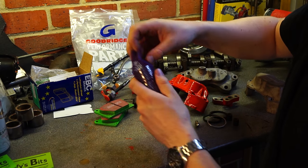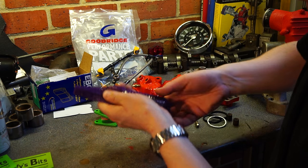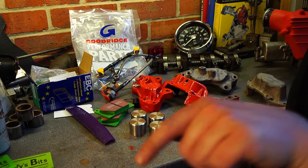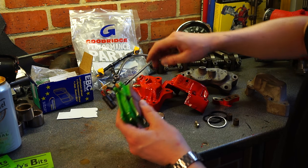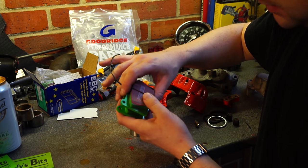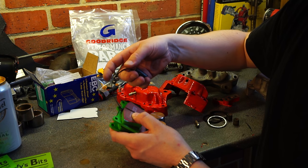Order yourself a set of stainless pistons — these just arrived today, actually. I'll put a link in the description below for where to get them. They're off eBay but a well-known company — not one of the normal mini suppliers, a smaller supplier that does machine work. These will never rust, so they're in there for life. For brake pads, get yourself some decent ones — these are EBC Green Stuff: low dust, which is another bonus, and well-respected pads. They're not stupid expensive either. The wear sensor just pulls out — it's useless on the Mini. I'll just keep an eye on the pads.